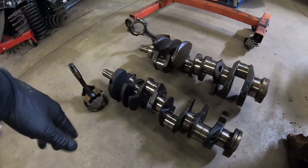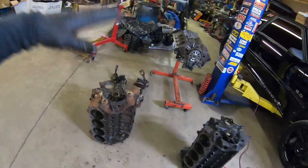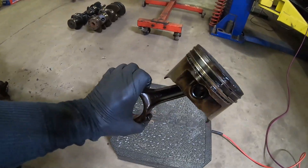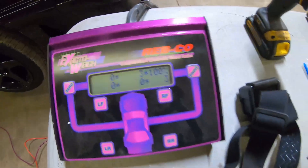We're only going to multiply piston and rod weight by eight since they pretty much weigh the same, so we're not going to try to weigh each individual one. I left the cylinder heads and intake out of it — the 351 intake is naturally a bit heavier since it's bigger and wider. The cylinder heads are probably about the same weight, because the E7 heads were the same heads used on the Fox Body Mustang '87 and up. The rod in this 302 is actually an F1 rod from an Explorer block — same gram weight as the D1 rod, someone had swapped it previously, but it probably weighs about the same.